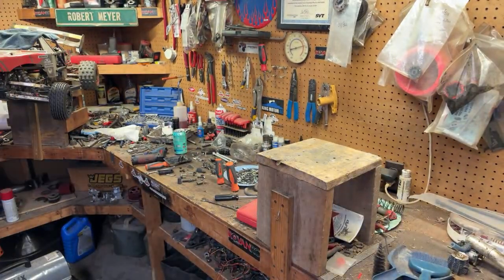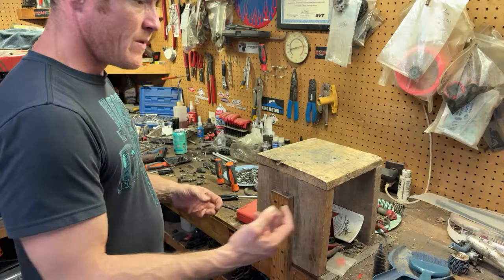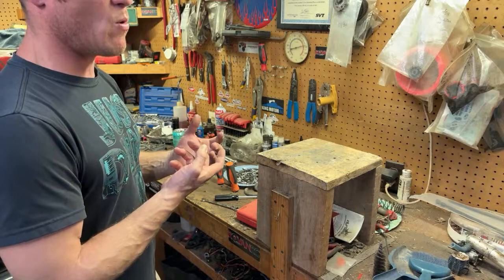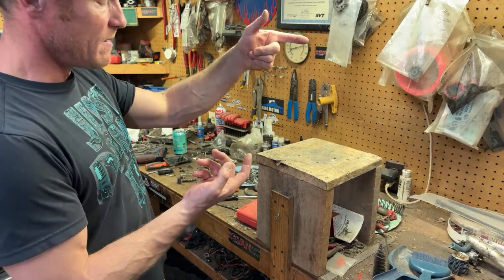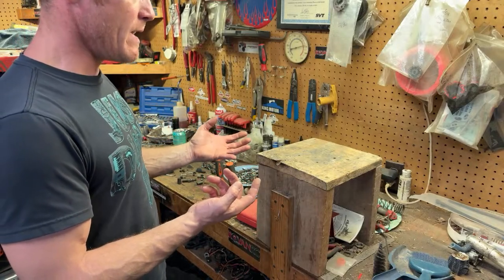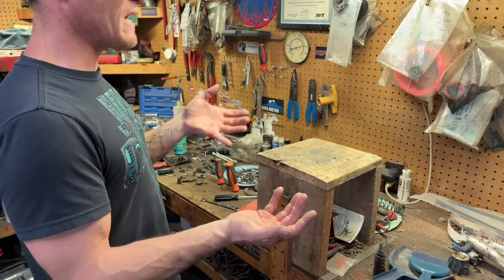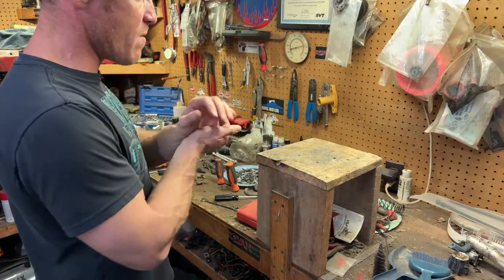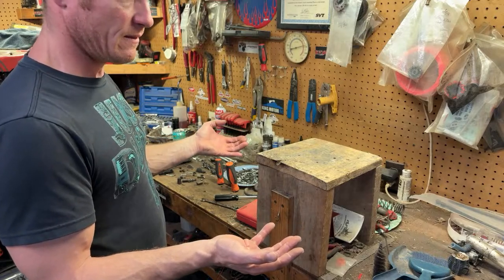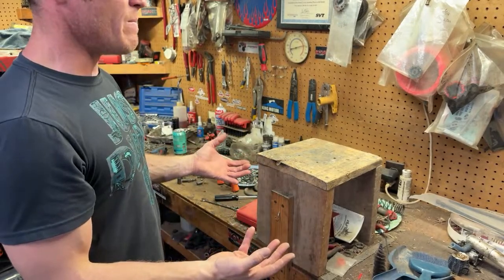That machine had a kill switch on it. Well, the throttle servo failed, and it locked full throttle. I hit the brakes, it wouldn't go off brakes. I hit the kill switch, it wouldn't kill. It hit a dirt pile out back. They had just brought a bunch of dirt for the farm, and the impact of that dirt pile must have jarred the servo back to where it needed to be, because after it hit the dirt pile, it went and idled. And I still could not kill it with the kill switch. I had to walk over there and kill it that way. And it had a remote kill switch on it.